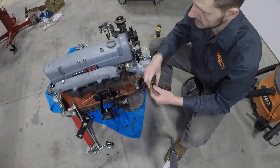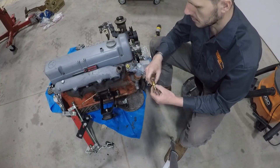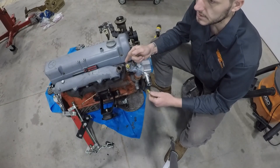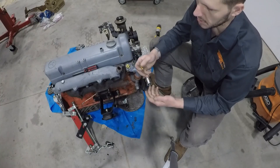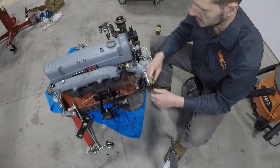Alternatively, on the left side of the engine, the heater hose works out really well. The Mercedes hose will splice together with the Toyota hose, so all you need is a 5/8 inch hose splice and the hose is made up perfectly.